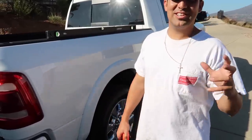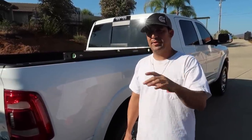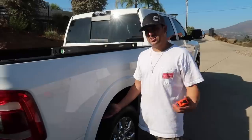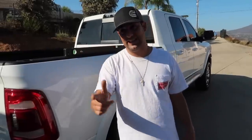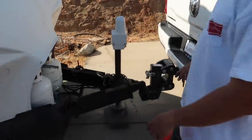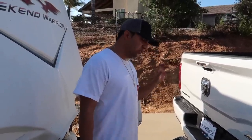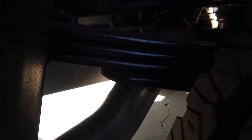Look at that expression on his face - he does not look happy. She needs some airbags. So guys, it looks like there is a big difference squatting-wise between the 3500 dually and the 3500 single wheel. You can see the amount of leaf springs on the dually compared to this one. It all depends on what you're towing and how heavy. Remember, we do not have the distribution bars, so this hitch is set up for a distribution setup - I'll need to lift this up. I'll do another video comparing squat with and without distribution bars.